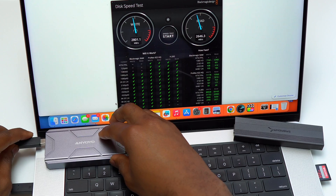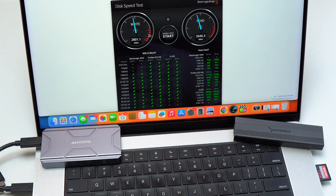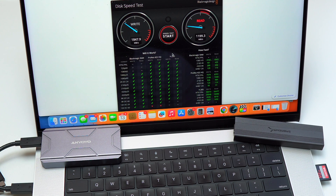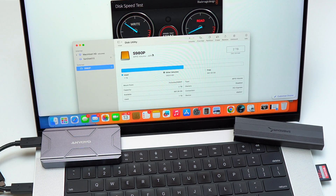This is the USB-C cable that came with the SanDisk Extreme Portable SSD. I'm going to test that USB-C cable with this new enclosure to see what kind of speeds I get using this inferior cable. I'm getting 1,800 — I've lost close to 1,000 megabytes per second on reading and writing. This test was simply to show that the USB-C cable is very important to achieve the higher speeds.